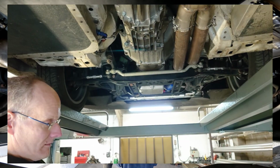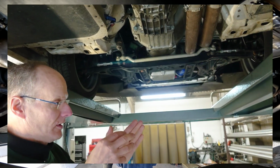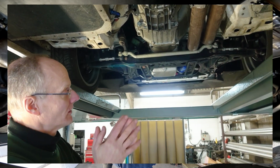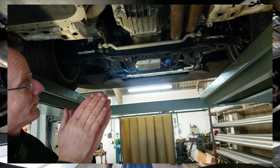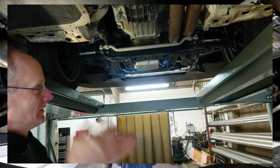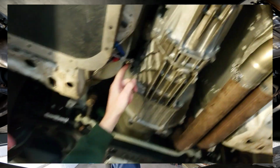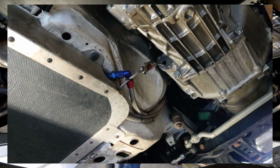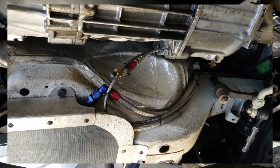And then a triple plate, 7¼-inch clutch with a pushed concentric clutch release bearing, I should say. So it pushes off the front of the gearbox to release the clutch. So instead of having any kind of fork or pivot pin, that's a completely hydraulic arrangement. You can see the hydraulic pipes here. And we've actually put a dry brake connector on there, which was hugely expensive, I seem to remember, for such a tiny little part. But it makes bleeding the clutch a lot easier.